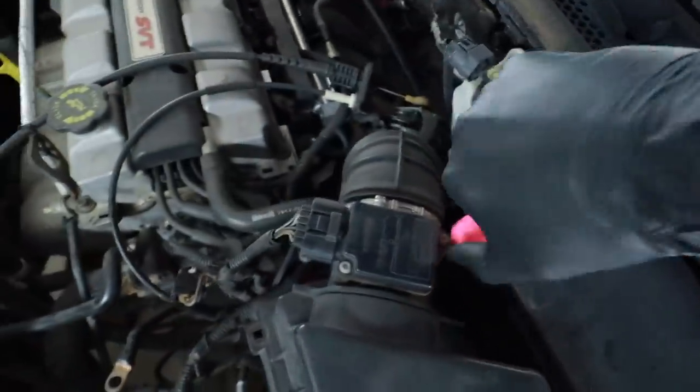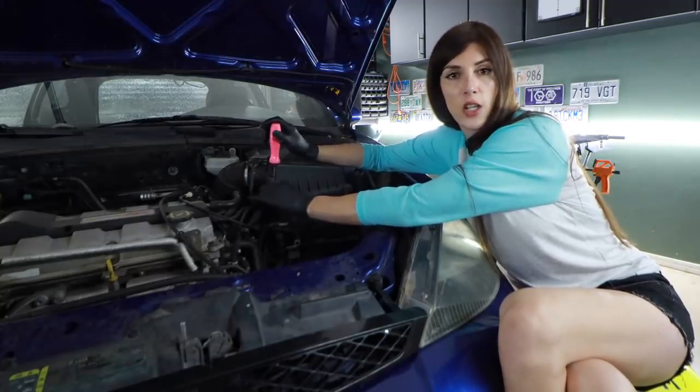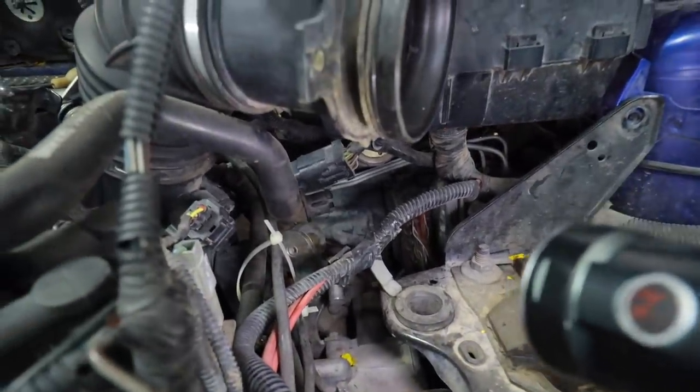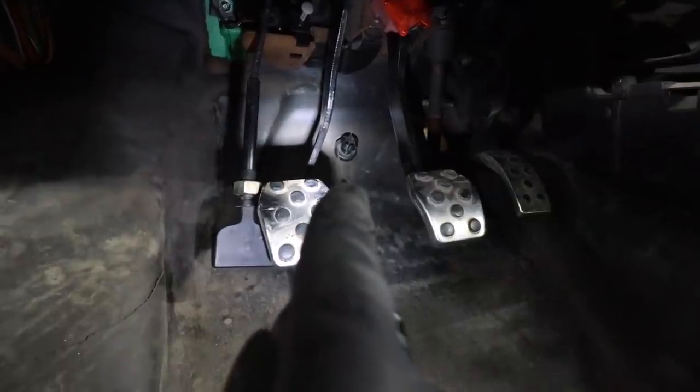It would have made more sense to do this battery relocation at the same time as fabbing up the roll cage, but I don't have anyone to fab up the roll cage just yet, and I'm not going to do it myself because it's something designed to save my life. I have a battery shutoff switch that I'm going to locate where my radio is inside the car, since I won't have a radio in here. Ford really doesn't want you modifying their cars — there's no access. There's a little rubber grommet already pre-made into the firewall behind the brake pedal, but I don't want my power cable that low, and there's nothing up top either. I'm going to have to make my own hole.